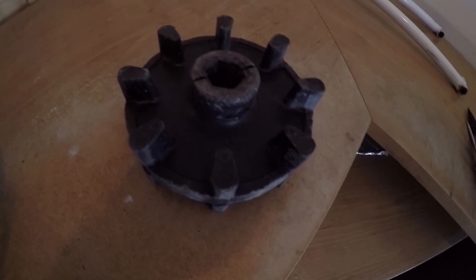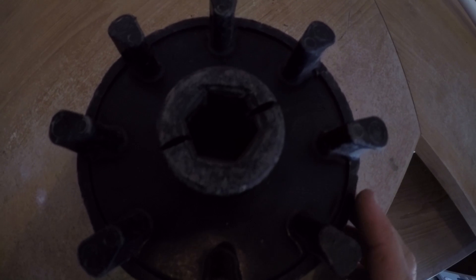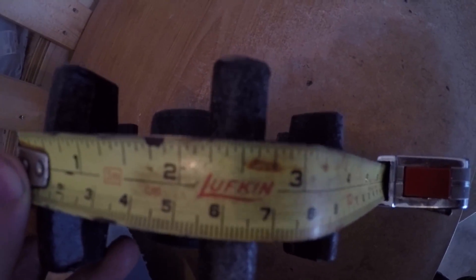Now you know about the tracks — let me show you the driver side of it real quick. That is a driver, which goes on the drive shaft. This is the piece that drives your track, and there are a whole bunch of different styles. This is a hex driver — it mounts on a one-inch hex shaft, which is what this was from. I have the end of the tape measure lined up with that drive lug, and this one lands at two and a half inches. So I can say that this is a 2.52-pitch driver. I'll go into different types of drivers in a different vlog — this one I just want to talk about tracks and track pitch.